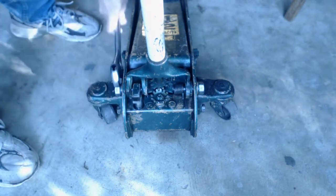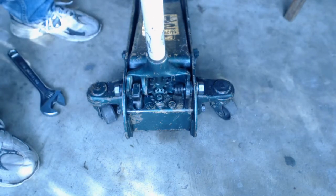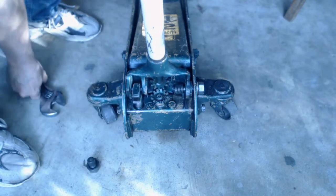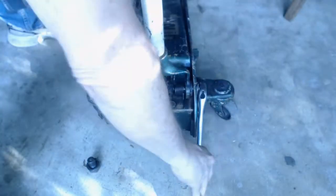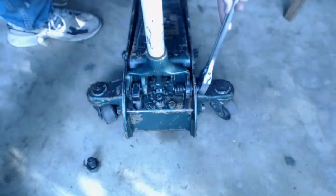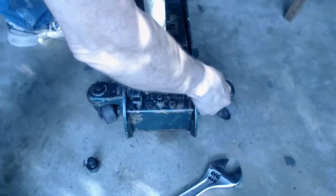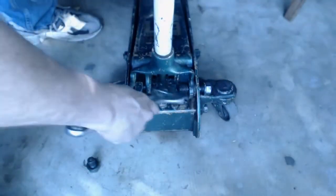Now as you're doing this, make sure the jack is all the way down and there's absolutely no possibility of any pressure in the jack by turning the handle until the jack releases. You might want to go ahead and just on the safe side put on a face shield when you get ready to take the handle off, just to make sure nothing can happen and you won't be covered with any oil should the plunger want to come back at you. Catching the actuator in the face if your jack has pressure could definitely be a real bummer.